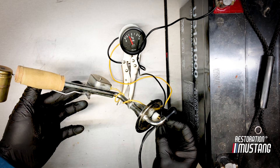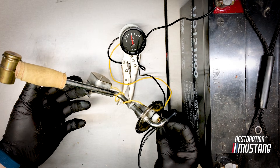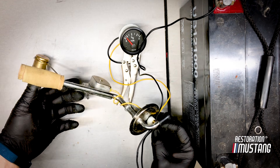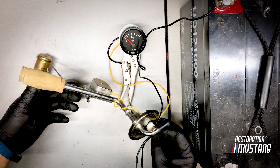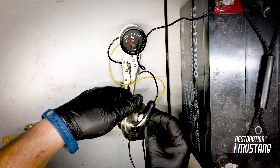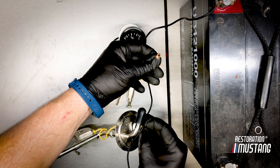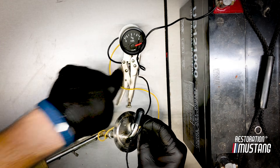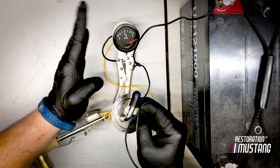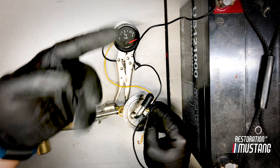This is a quick way to test your fuel sending unit. I was underneath the car, driving myself crazy. I put the gauge in, had it grounded and all set up, put in a new fuel sending unit, and all I got was a straight full reading on the gauge — that's a problem. The way you can tell you have a wiring issue: say there's a break or a short between the fuel sending unit and the gauge. I'm going to pull the sending unit line off — pretend there's a break in the circuit. Look at where that gauge is sitting: it's past full. There's no resistance in the circuit to bring that back down into a reading range — absolutely useless. This is exactly what my gauge was doing inside the car, so I knew I had an issue with the wiring.